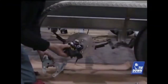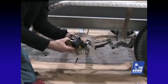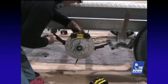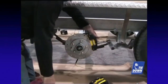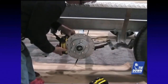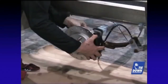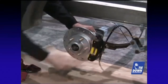Your G5 brakes come with pre-assembled mounting brackets and stainless steel slider pins. Do not remove the slider pins. If slider pins are removed for any reason, the threads must be cleaned and a new coat of permanent Loctite must be reapplied. The preferred positions are 12 o'clock or at the top, 9 o'clock to the front, and 3 o'clock to the rear. The brake flange will determine your exact positioning. Consider where the brake hose will attach to the caliper so that the hose will not rub on the trailer frame or be in a position where it can be damaged.